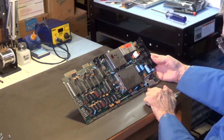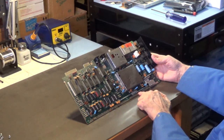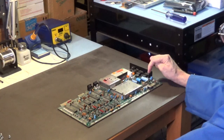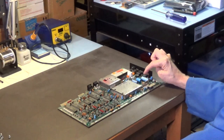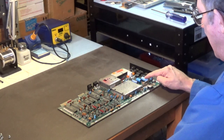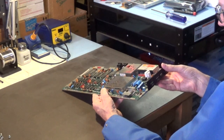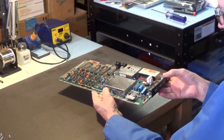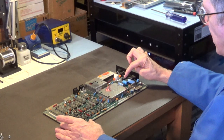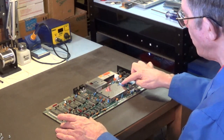This one here is revision, I think you go by this number, 250407. Okay. Now, normally, the Commodore 64 motherboards have, I think this is a 2,200 microfarad, I believe it's 25 volts. Actually, this is 16 volt for this capacitor here. And they usually have two, I think these are 470 microfarad, 25 volt, if I'm not mistaken. That's what these normally are. But in some of the revisions, like this one, instead of a 470 microfarad cap right here, it's I believe a 1,000 microfarad for here.